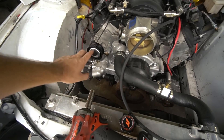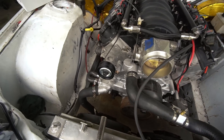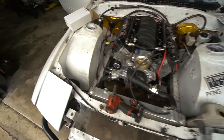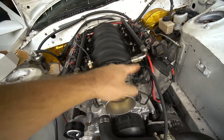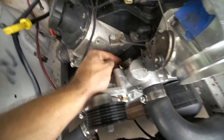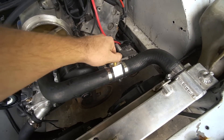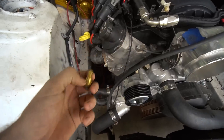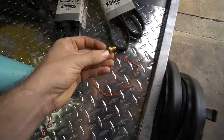Now that the tensioner is on, we need to figure out how long our belt needs to be. Since we're not running power steering right now, we just need a belt that bypasses that. Put some string around to measure, did some quick internet research for a belt size, and we're going to try that first. We also need to tie the steam port into the cooling system — it allows air bubbles to get out of the top of the head and needs to go back into the cooling system. Going to get a barbed 1/8 MPT fitting for it. Taking the Sephy on a quick parts run.